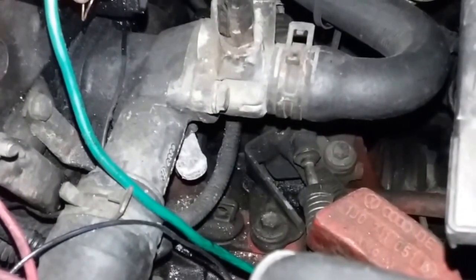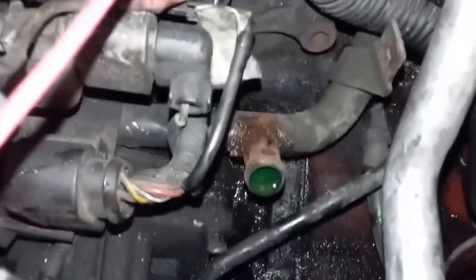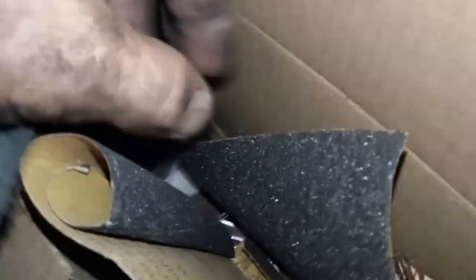You can see the two connections on the oil cooler. Over on the driver's side of the engine is the other nipple, which faces the transmission straight down. We're going to have to clean all these connections before putting any hoses on. I keep a box full of sandpaper, wire brush, and scotch brite. Start with the coarse stuff — knock some off with the wire brush, then wrap a piece of sandpaper around it and twist, then finish with scotch brite.